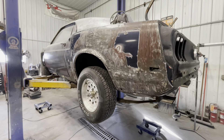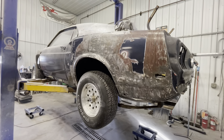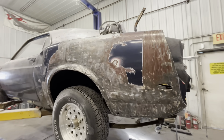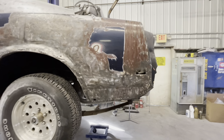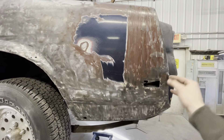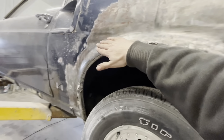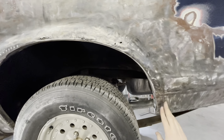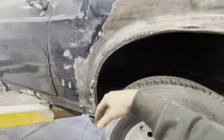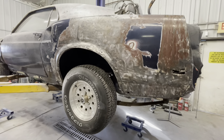I really, really don't want to re-quarter this car. I'm going to do some debating tonight and some researching. What I'll likely do tomorrow is take the stud welder and go along here, run the slide hammer, see if I can pull some of this back out, get it to line up, knock down the high spots, pull up the low spots, and get some hammer and dolly work done. Then weld up the issues and go through it with kitty hair and a really light coat of filler.